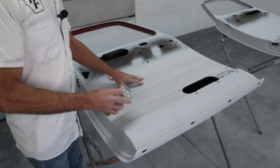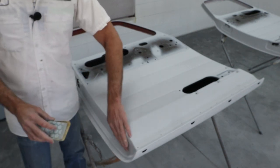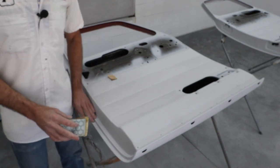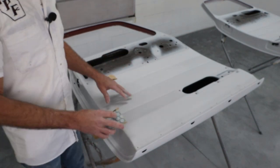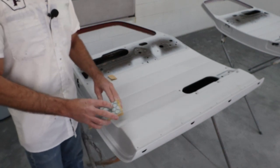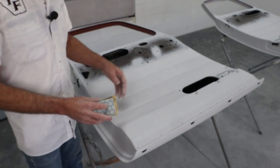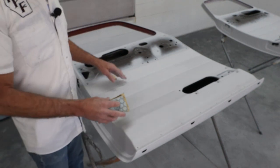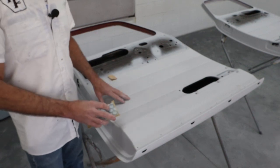So let's just jump into sanding here. We've got these grooves to take care of. We want to go over the jambs lightly to make sure they're all nice and smoothed out. And then when we spray the seal coat of primer on here, all we have to do is some really fine sanding just to get it prepped for color and clear. So let me jump in here and start sanding. I'm not going to bore you with a lot of that. I'm going to go over it real quick, and then we'll come back and talk about some of the areas and how to address them.